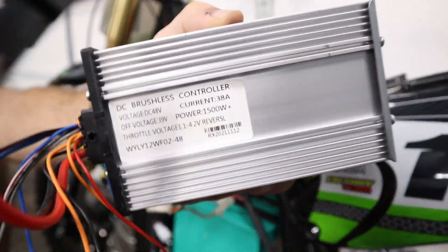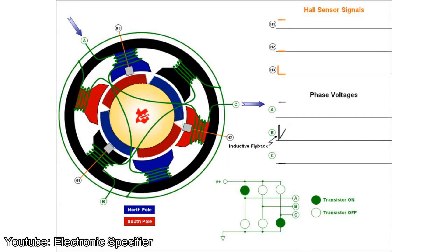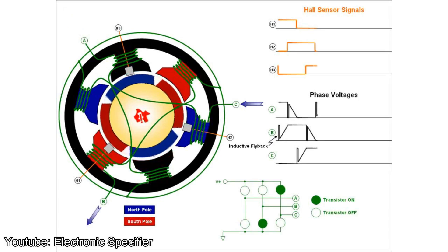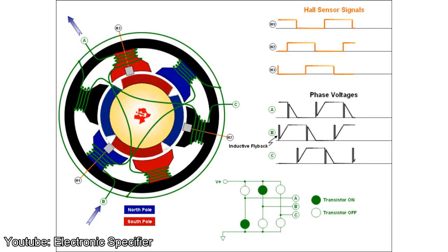What most people are used to using is a standard brushless DC controller, like this one. This is what came installed on my bike and it uses a square wave style of power output, which sends signal from the battery to the motor along the phase wires. This essentially pulls the magnets inside of the motor in the direction of rotation. The DC signal can be torquey, but it is inefficient, and while it does allow for a higher top speed, that top speed will always be limited by the voltage of the battery.